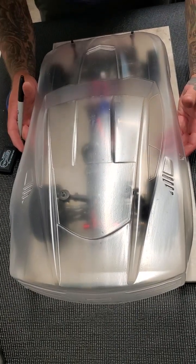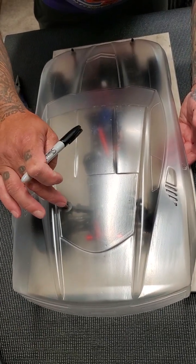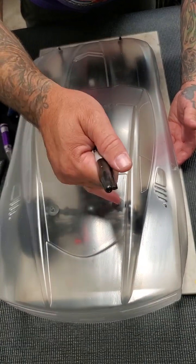And then your eye can catch the lines. Like, see, this right here is the body mount bolt that's going to go through the body. And I line that up and say, you know, that's about a 1/2 inch there, and it's about a 1/2 inch there.